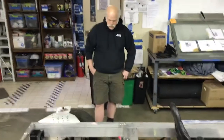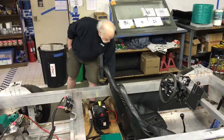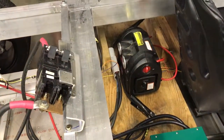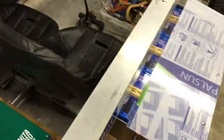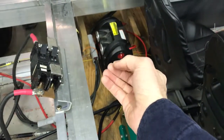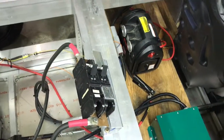If these two terminals were fully covered, what else would be a danger point for kids around the car? If they got underneath the plexiglass cover, or if they put something into the back here, or inside the plugs. But barring that, if the packs are covered and fingers don't go inside, or if we pot in the cabling, these are the only points to cover right now.